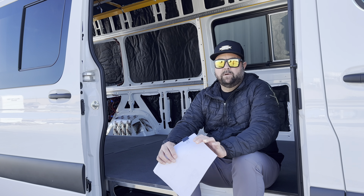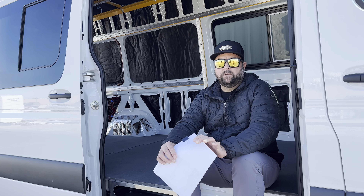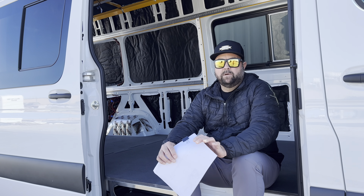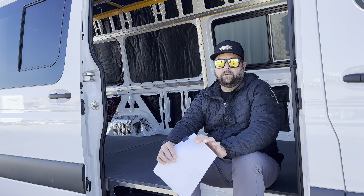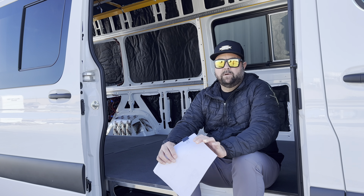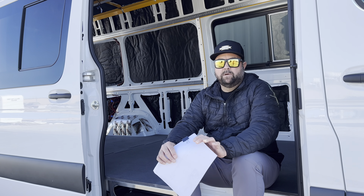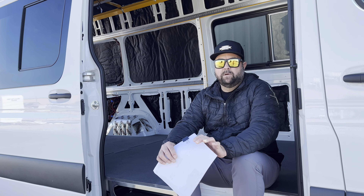DR-L2, 50.5 inches — a little different, not universal like some of the others. The upper piece transfers over the top of the L-Track with the seam on the edge. DR-U2 goes over the top of the vertical, and DR-L2 dead-heads into the vertical. The frontward mount hole is in the very first hole of the L-Track. The rearward hole towards the back of the van is in the second full round hole with a half hole there.